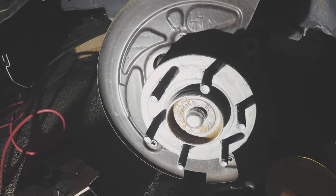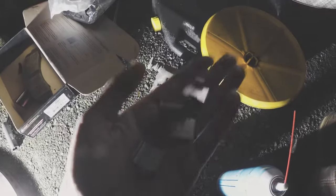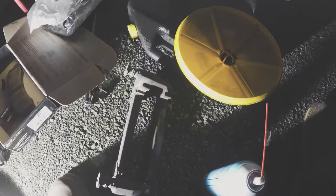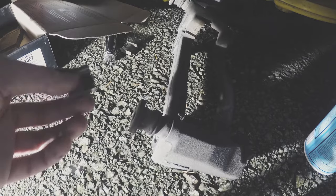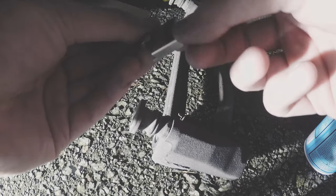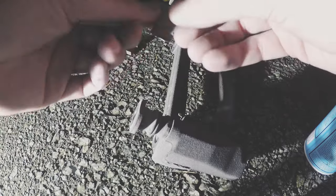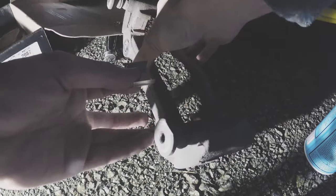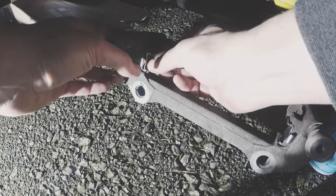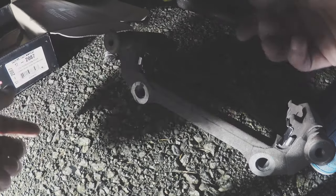Now it's a little darker but as you can see I'm on the opposite side. For the caliper bracket, these tabs — you can either put them on now or put them on after once the caliper bracket's back on. With these tabs, put this little tiny piece in first on the top and then click this down, and it should click in like that.